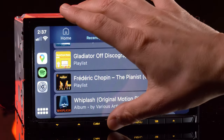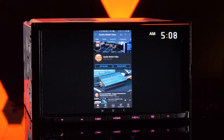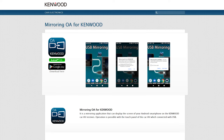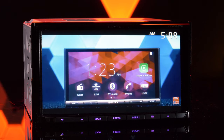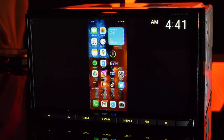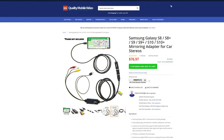Both will display album artwork onto the home screen when in use. Kenwood added the new feature of wireless or wired Android screen mirroring and even wired iPhone mirroring. In order to perform this, you must download the Kenwood OA mirroring app from the Google Play Store. This app does not open when you click on it because it's not designed to — you must go into settings on the stereo and change the mode from Android Auto to mirroring for Android or iPhone. You can also screen mirror using its rear 3.5mm AV jack input with the Kenwood CA-C3AV cable.